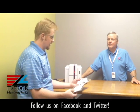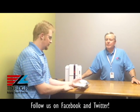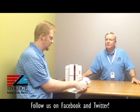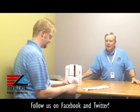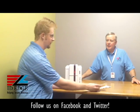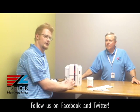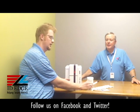The cleaning kit that we're going to use today is the advanced cleaning kit. This comes with everything that you need to fully, completely clean the printer. Otherwise, you can get just standard cleaning kits that come with little adhesive cards and a little alcohol pen to clean your print head. So without further ado, we'll just go ahead and open up all this. And these kits usually come with 2 adhesive cards, 2 alcohol saturated cards, 1 container of cleaning handy wipes, and then 1 cleaning pen.